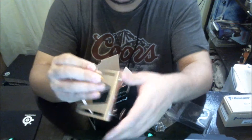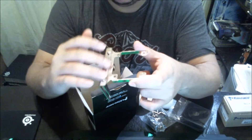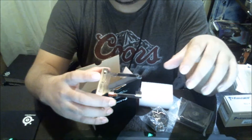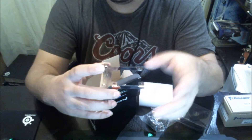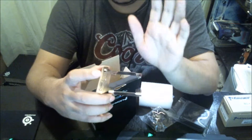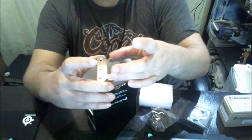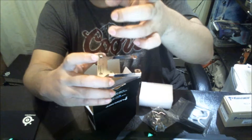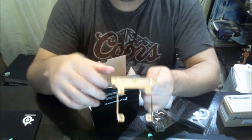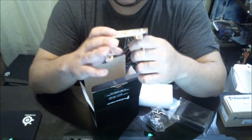This is the most important thing I like about the Revision 2 compared to the Revision 1. On the Revision 1, you can never adjust this, and the four hose port is off center. The way you had to mount it on Revision 1 is at an angle for your DDC pump — on this one, you don't. It just mounts straight. And the good thing is you can adjust this anywhere from 80mm to 140mm.